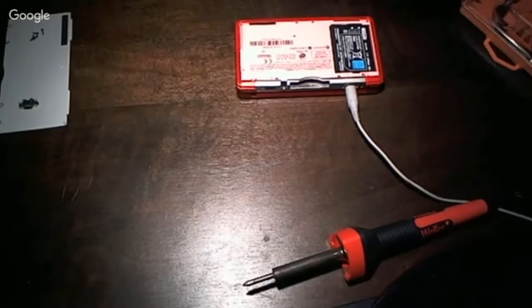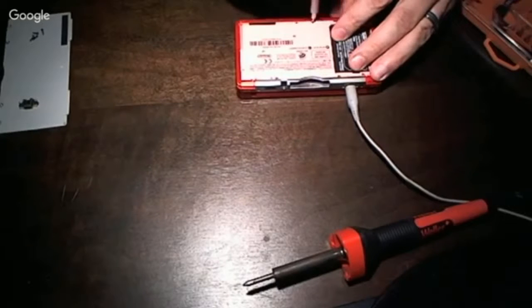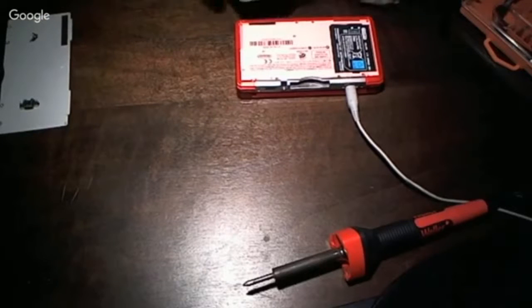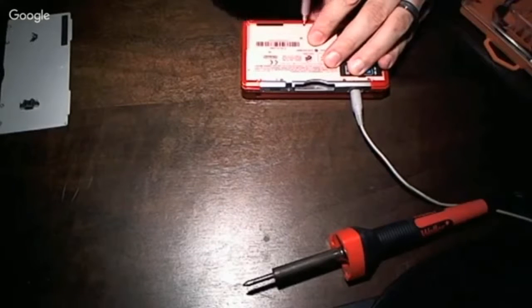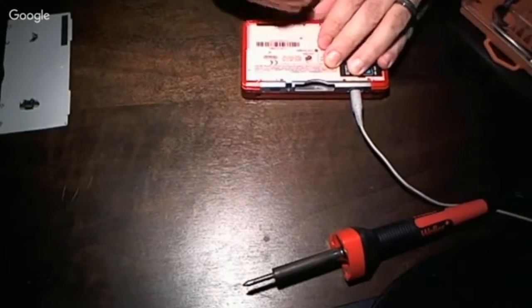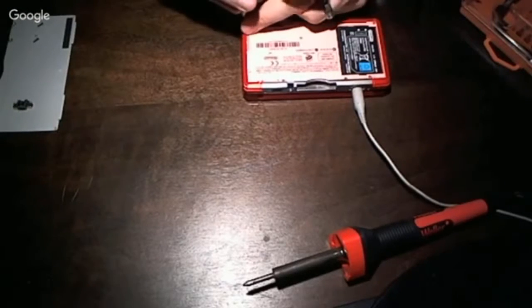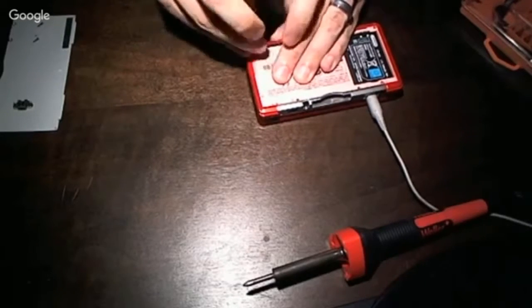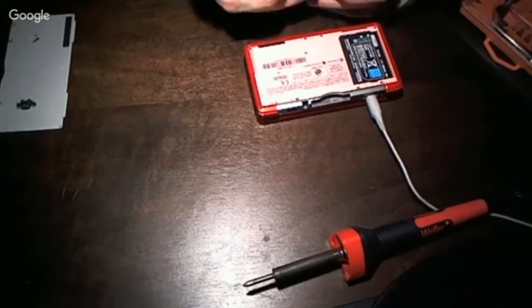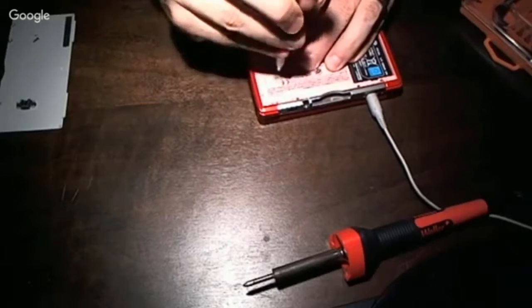I've had some where they charge fine for like 5 minutes and then go dead. That's generally going to be just bad soldering on my part. Sometimes the prongs aren't in a very good direction to lay flat with the PCB logic board, and it had a good connection at first, but after the unit sat for a bit, it sort of dried out and provided a bad connection. Usually I just take it off, start over, and flatten the pins out correctly.